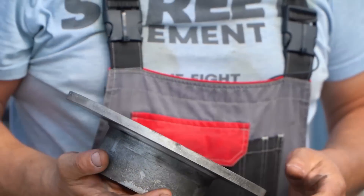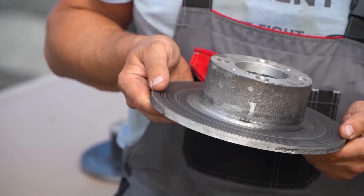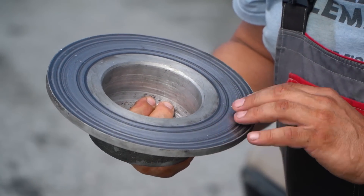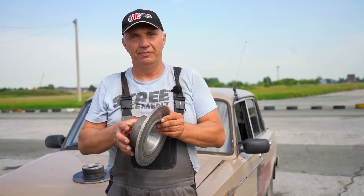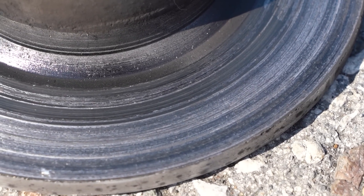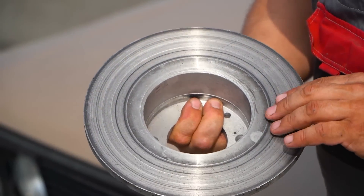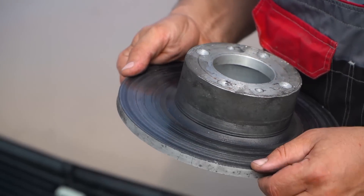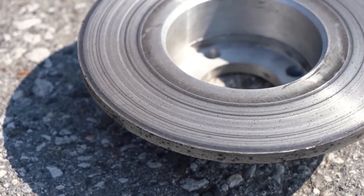Okay let's have a look. We've removed them, and here's what they look like. These definitely have some grooves in them, as they would. But I was expecting these to get severely worn down, which isn't the case at all. You stop a couple of times and they're shiny once again. The wear is even. But one thing I don't understand is why the brakes just cease to work — these don't look at all distorted. You might remember how we used aluminum pads, and those literally got stuck to the iron; the metal would get stretched and disfigured. Not the case here. Honestly they don't even look that bad — there is some wear but it's not horrible by any means. Lots of scoring, but no extreme wear or metal stretching out. Let us know in the comments why you think the brakes stop working, because I don't know what's going on.